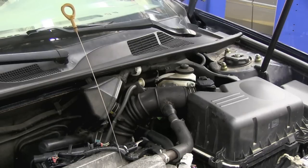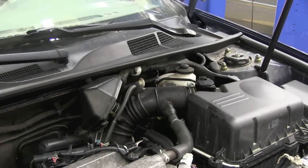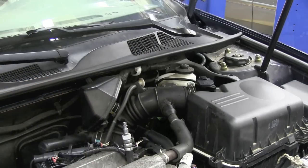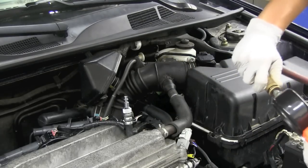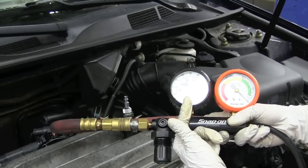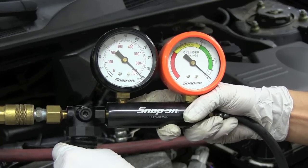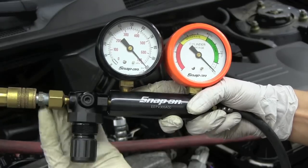That should be top dead center right there — it is kind of tricky and takes a few times to get used to. Now we just screw in our adapter and we're ready to hook up our gauge. The cylinder leak-down tester operates off of shop air, so we plug this in, pull the collar back, and release. Then we look at our pressure-going-in gauge and pull the regulator down to adjust it so that only 100 PSI is being sent through the regulator, through the hose, and down into the cylinder. Then we close it.